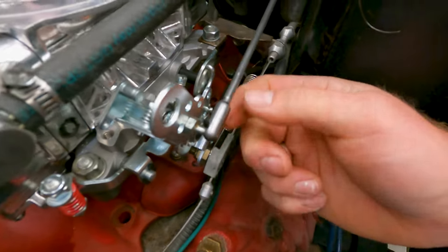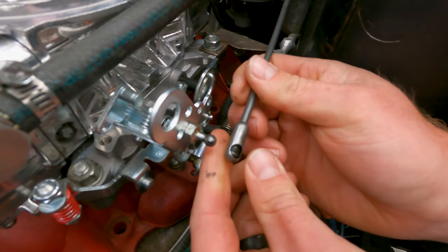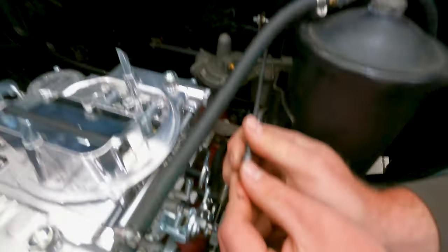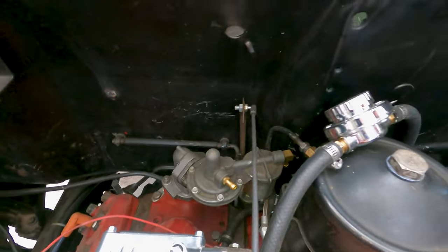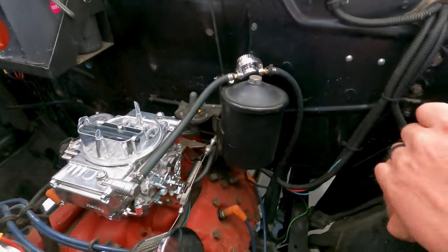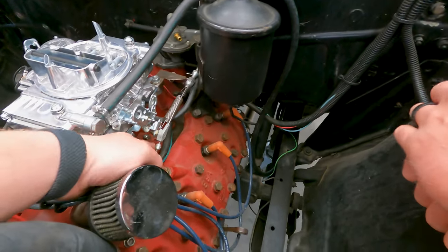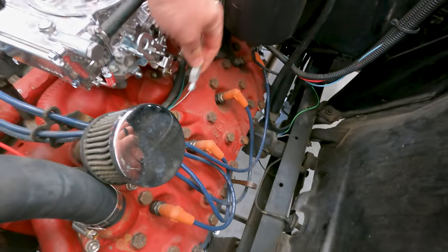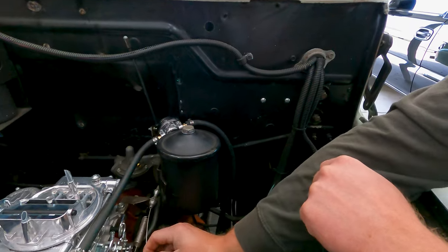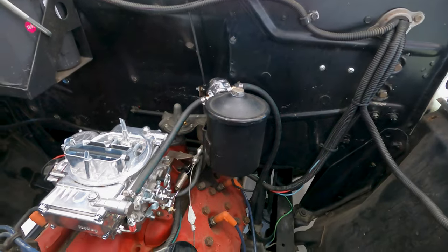Here's a little cool feature from the '50s — if you pull this rod forward, it's got like a spring in it, just goes on a little ball. That's awesome. That goes to like a little dog-leg which goes down into the car into the wiring. This is the transmission kickdown cable — it'll come off with this bolt, and then this actually just slides forward and off. See, that's that simplicity I'm talking about.